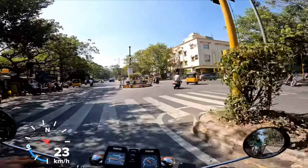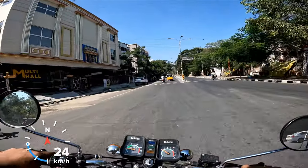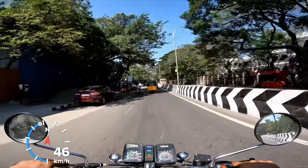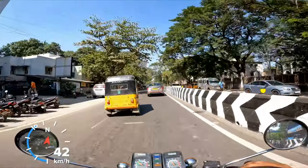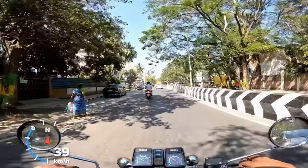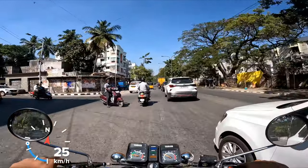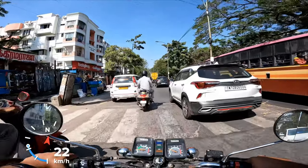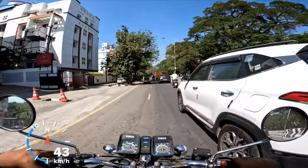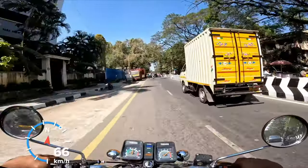This is a very high-duration build in the sense that it's tuned for top-end, and I've geared it in such a way that it reaches the higher RPM as soon as possible. It's also possible for you guys to do a stock sleeve job — that means all the ports exactly match factory spec, no performance modifications — you do the sleeve and get back to standard size, giving you the best possible balance between performance and mileage. Now that I've had a lot of fun with this setup for almost two years, I'll be switching back to the stock four-speed setup — the head, carburetor, and block will be four-speed — with a sleeve job but without the extra porting.